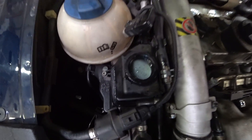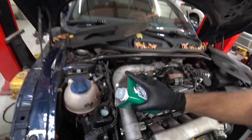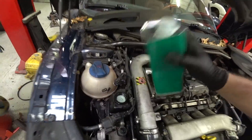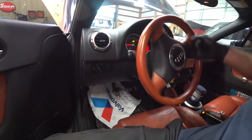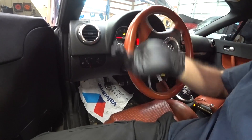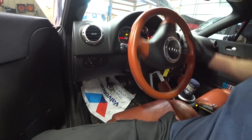We just want to try and get all the air bled out. Leave it over there for a second, check the level, make sure it's full. It's kind of hard to tell if it's full or if it's just bubbles — add a smidge. A lot of bubbles in there. Go back and do the same thing back and forth until you stop getting bubbles. You might have to go out and drive it too — sometimes it might not get all the air completely out for a while, so don't freak out. It should stop after maybe 10–15 minutes of driving as long as the reservoir is full. If it doesn't, you could be looking at other issues — or you could be driving a Ford. Fords are known for making this noise all the time.